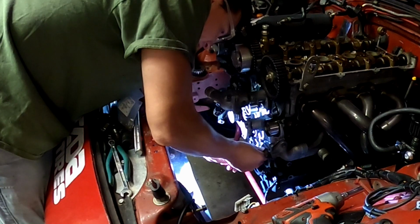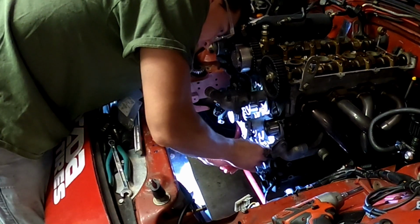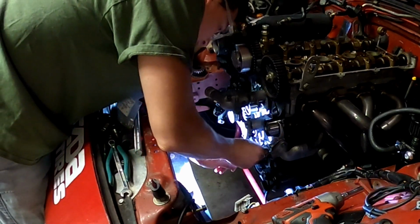And you'll also notice that I didn't just keep it on one high side when I was grinding. I'm moving it around. Just like when you're doing body work, you don't sand in just one spot. You don't sand just where you have the Bondo. You need to feather it.